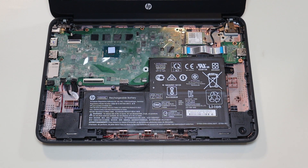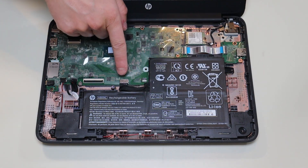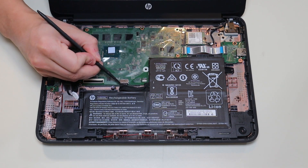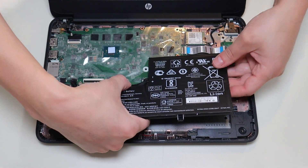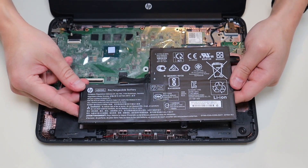Before I touch anything in a computer, I either remove or at least unplug the battery. A computer is safest to work on when as little power as possible is running through it. To remove my battery, I have a single screw here and the battery plugs into the motherboard right there. As with any wires in a computer, you want to avoid pulling on the wires themselves if at all possible — just manipulate the plug. However, these plugs don't have a lot of grip on the edge, so I had to lift the battery up, get a firm grip on that battery cable, and wiggle it out gently without damaging the cable.